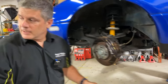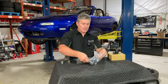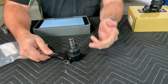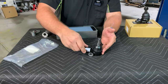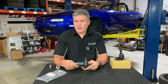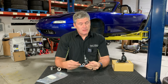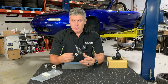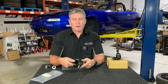This is a factory Mazda lower ball joint. It's a great big beefy thing - it has to be, because all of your cornering forces go through this. The upper control arm is mostly there to keep the wheel from falling over; this is where all of the forces get passed through, including when you hit a curb mid-corner. There are a lot of big shock loads that go through this, so you want to make sure you have a very good quality lower ball joint. There are some cheap knockoffs, some non-OEM versions out there. It's a tempting place to save money, but it's not a good place to save money - a failure of this part means your wheel has just lost contact with the lower control arm and you will crash. We strongly recommend using good parts from a top quality manufacturer. That's why when we sell stock-size ones, we sell actual Mazda ones.